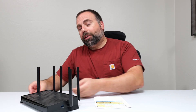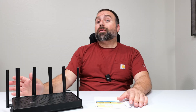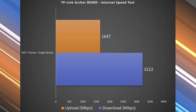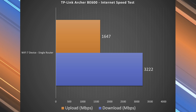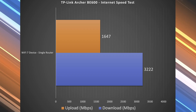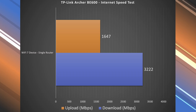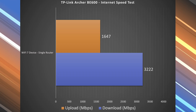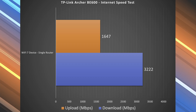I haven't seen any Wi-Fi device reach 5 gigs, at least not as of now. When we do the Wi-Fi speed test, we actually get faster download speeds than over Ethernet, because at the source it's still 5 gigs. Doing a speed test near the router, I got 3.2 Gbps down and 1.6 Gbps up. On Ethernet I get basically just under 2.5 down and just under 2.5 up.